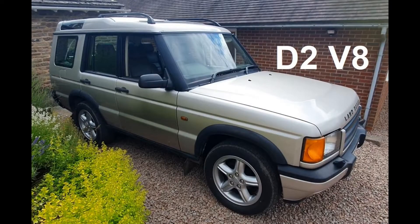Hello YouTube, welcome back to this series on the Discovery V8 4L engine rebuild. In this video I managed to skip entirely stripping down the cylinder heads, but we start from a stripped set of cylinder heads and look into what I've done to recondition those. One more thing to mention is the crankshaft — at the end of the last video you can see it needed regrinding. The crankshaft has already gone to the machine shop; it is being reground, the mains and the big ends, and we'll get some oversized bearings for that. But here we are, back to the heads.